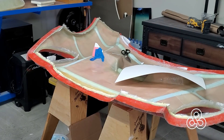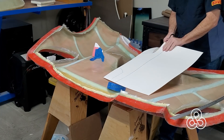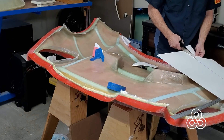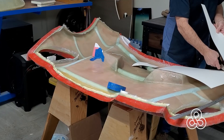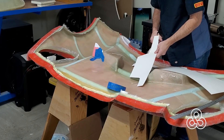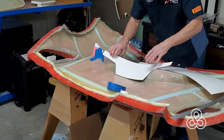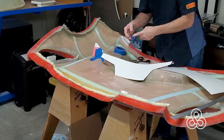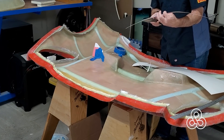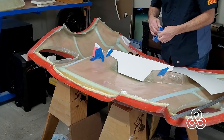That'll keep the air between those two crash structures going through the radiator and then up through those nose holes. It's not going to help too much to just have a little card on both sides - I need to duplicate it on the other side - but I'm also going to build a template for a little air dam to go between the nose holes. So in the end, when that bonnet closes and the clamshell comes down, the radiator air will have to travel through the radiator and through those nose holes. Although there will be a slight gap above them, that extra air can travel past the nose holes and exit out onto the windshield - we just don't want all that air going across the windshield. Some will also escape by the sides and go out the wheel well as well.